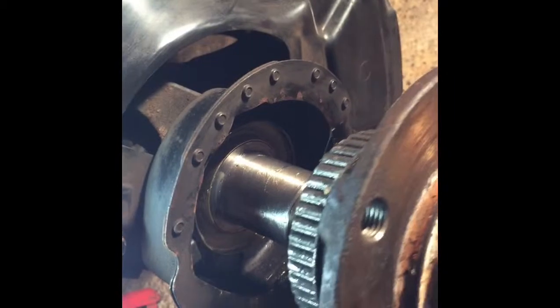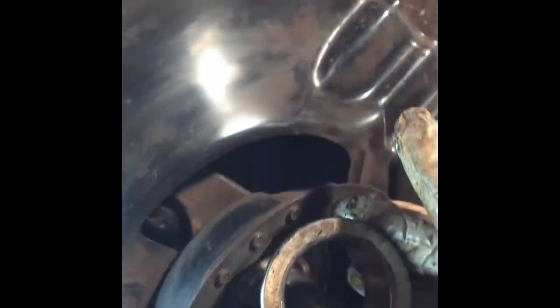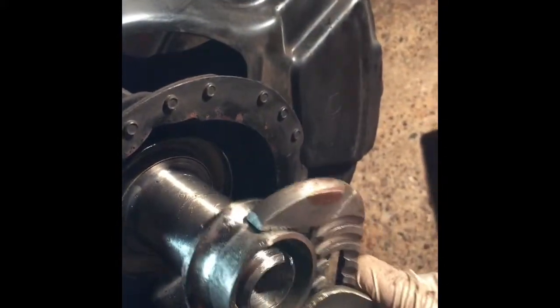Okay, moving on. After I remove the wheel bearing nut, it's actually pretty simple. After you remove the bolt, you just pull on this one, and you will get it. However, this wheel bearing assembly consists of 2 races. I performed the job on the other wheel, and I had the same thing happen: the rear race will stay in there. You will not be able to remove the rear race. So you're going to take a set of pliers and grasp it like so, all the way in, and gently pull it out. It should come out.